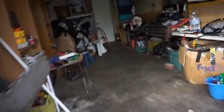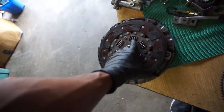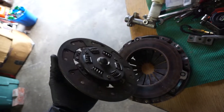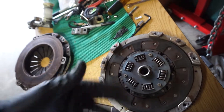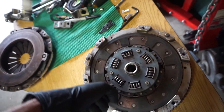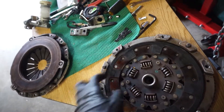The difference from the old setup to this one is the issue I had with the Fidanza flywheel. This is my old Clutch Masters Stage 3 — same clutch, same flywheel. This clutch wasn't even worn out, and with this one I drove to Vegas, Los Angeles, Malibu, Newport for hours with no issues at all — I loved it. The new Fidanza flywheel had that green coating. The clutch was actually mated to it before the car even started, and that's when I started breaking down all the points where things can go wrong. I had to pry the trans off, and you'll see in the pictures that the friction coating merged onto the Kevlar part of the clutch.